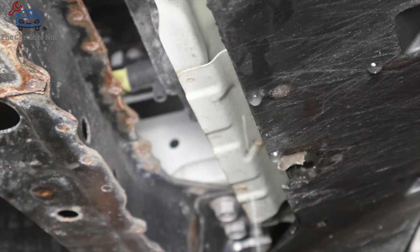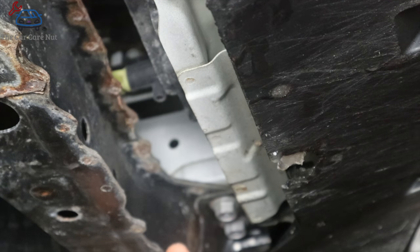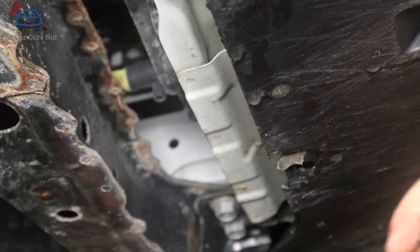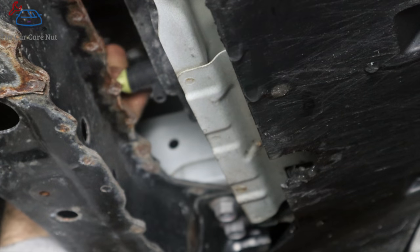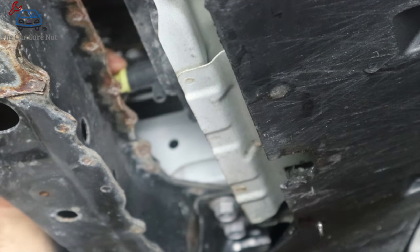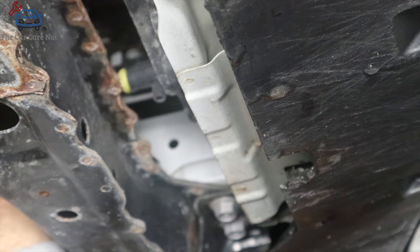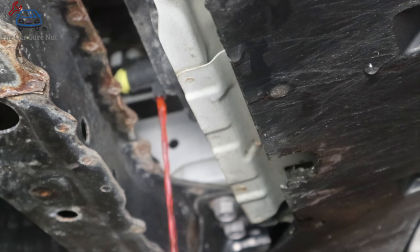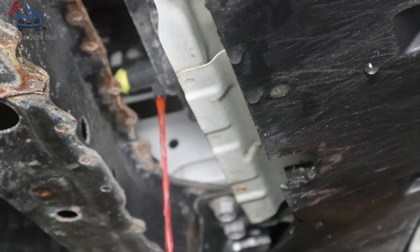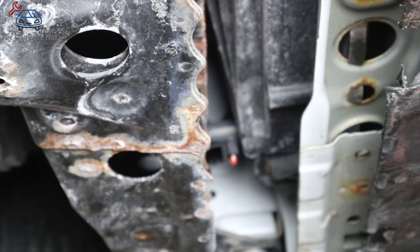Now we're going to drain the radiator. Most Toyota radiators will have a drain just like this — place your pan underneath it. It'll usually be at the bottom of the radiator to one side, either driver's side or passenger's side. In the case of this Prius it's to the driver's side. Go underneath and open the yellow drain cock. If you have a hard time, you can use pliers to turn it slightly. Turn it until the coolant starts draining, then let it drain — this one is going to take a long time. Wait for nothing to be coming out, then close the drain, reinstall your shield, and let's go bleed the car.